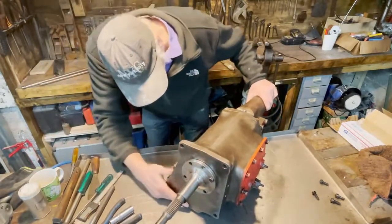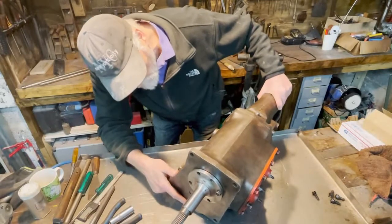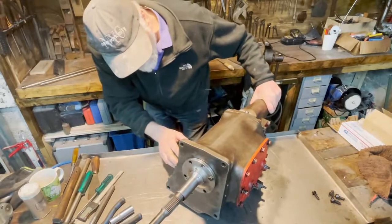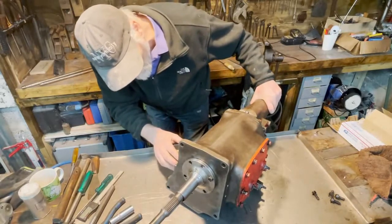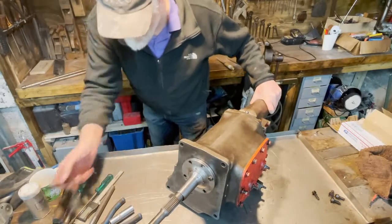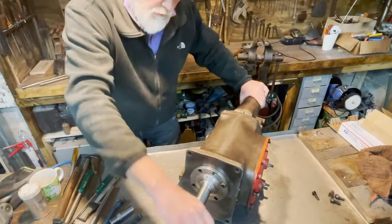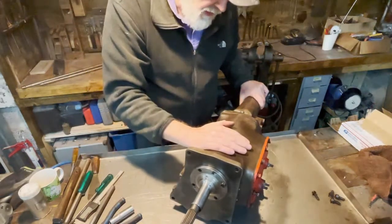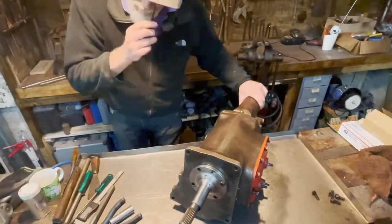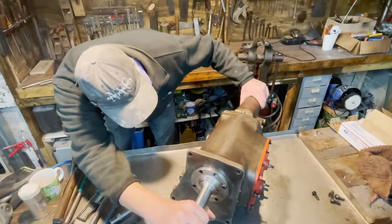Well, it says 0E127520. That means 1970, E is Los Angeles, and 127520 is a rather early production. It's not a matching transmission to the Green Challenger, but it is as close as I can get for the moment. We also have some other numbers here.